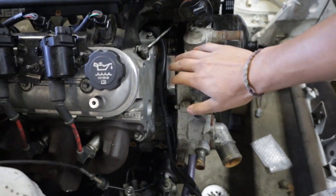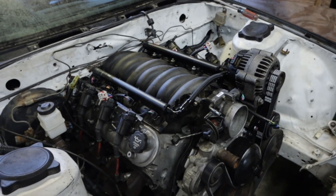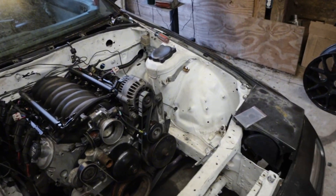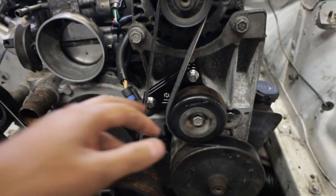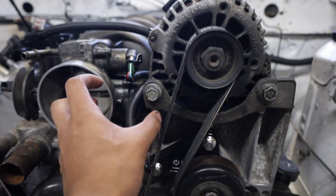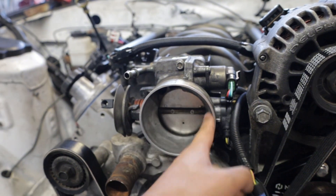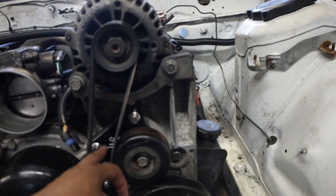I kept the truck spacing. I'm gonna try to link a lot of these parts in the description below because I'd love to help you guys out — I don't try to gatekeep anything with my builds. Apart from that, I went ahead and did the idler pulley relocation — usually it sits up higher, but since I'm going with the LS6 intake, it would block the throttle body intake hole. So I bought a relocation bracket and moved it down.